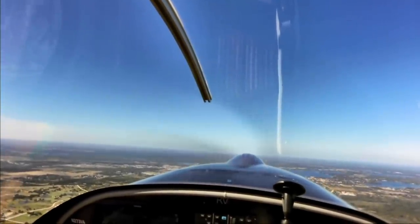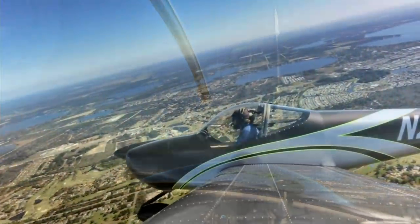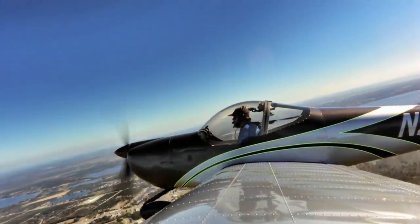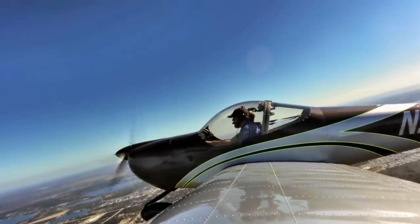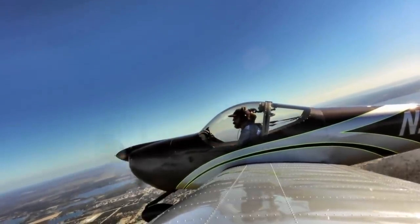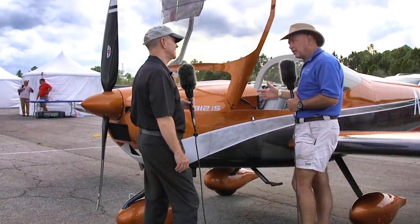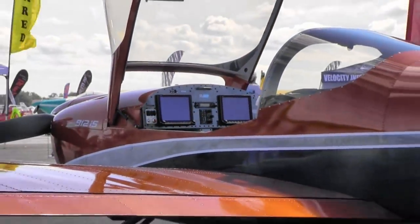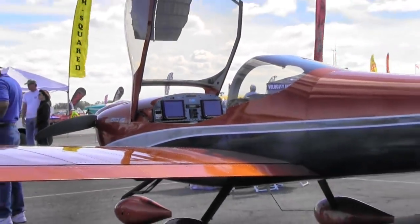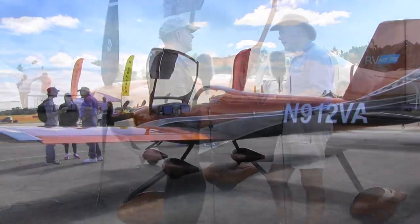And the neat thing about today is we've come just as far with, I think it's a 20-plus amp alternator for real, as opposed to your voltage starting to drop off. Now we've got all LED lighting as well. So it's funny, we have an airplane here with all the toys you would want. You know, dual screens, ADS-B, full autopilot, night legal with wig-wag, dual landing lights and everything, and it runs about 10 amps in flight. Is that right? It's very, very nice. Even close to its capacity generation then. No. Yeah. Excellent. Good stuff.